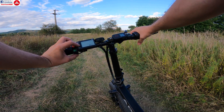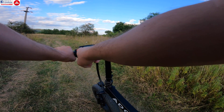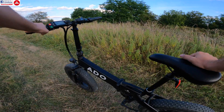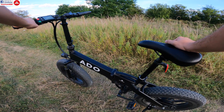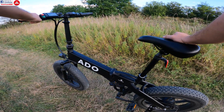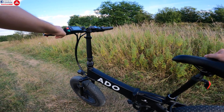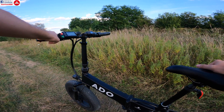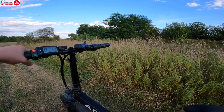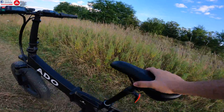Let's turn this off again and select assist-only mode — just the brake lever pressed while powering on — and wait about 10 seconds so the controller knows I want to pedal and have three assisted modes. Now I'm on third assist mode with no accelerator. Let's hop on the bike.